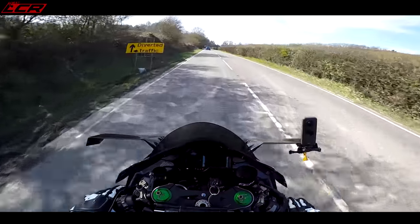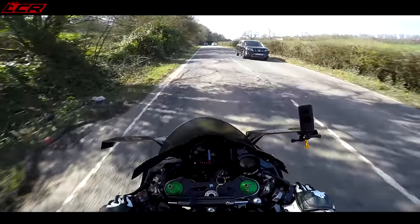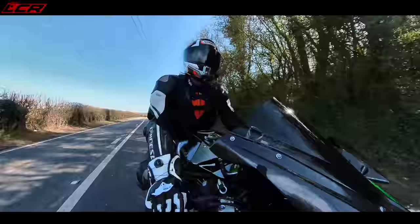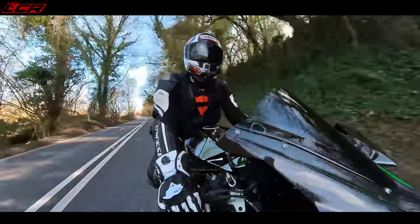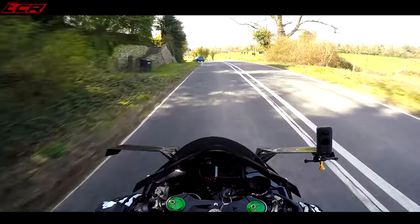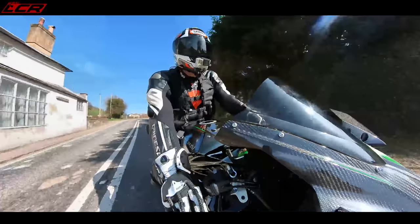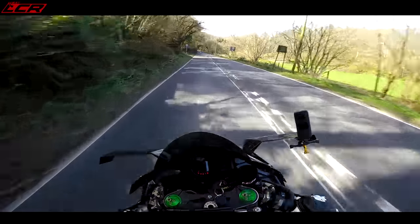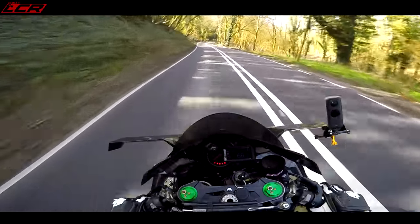The other thing I was really unhappy about was the brakes. They used to be quite flat. I'm still bedding them in — I haven't done many miles on them — so I'm trying to take it a little easy, but already I can tell with minimal lever effort it's stopping much easier. I think those were the FPS sintered pads, the R90s. They definitely deliver a lot more initial bite. The brakes worked before, it was just lacking initial bite — you'd have to pull the lever quite hard. That seems to have sorted that.